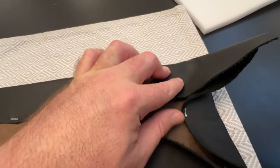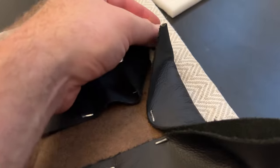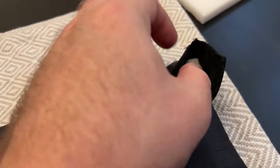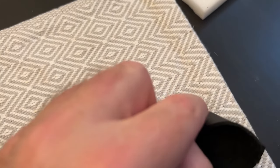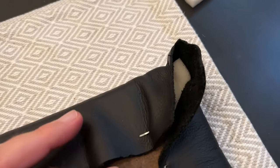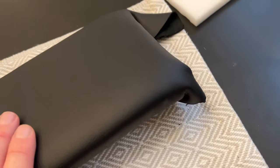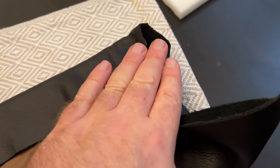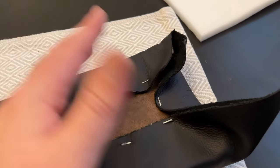Pull the side tight all the way near the end and sink a staple in there. The corners are the only tricky parts — trim them down a little bit as you need more working space. Come around, get the corners looking good, do staples where you need them to hold things in place. Pop staples out that are behind and reposition until you get it all looking good. Make sure you're flipping it over and checking the top — the bottom can be as messy as needed, but the important thing is not to build up layers of leather. Trim off everything extra between the staples keeping the top looking good.